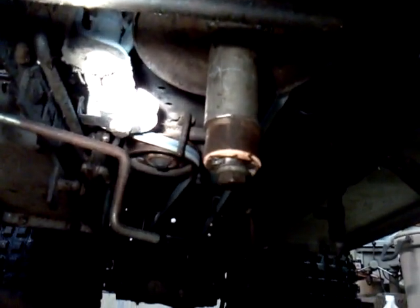Okay, it's all done. It's been sitting out in the rain. I did the front pulley swap — you might be able to see that — 6 inch in the front. I finally got my belt done. Stock clutch, it was a 94 inch belt, and I got a Kevlar belt. You can see it's a blue belt, goes back to a 6 inch pulley in the rear.